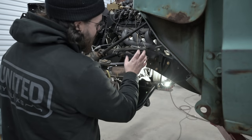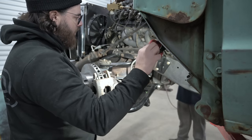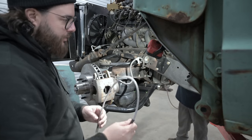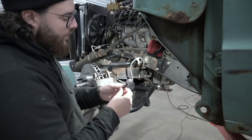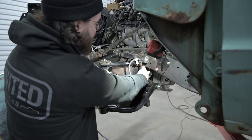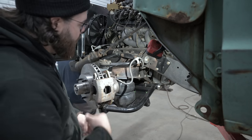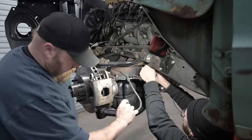Alright guys, so we're going to be working on the brake line here. These factory brake lines, especially with this little bend here, always cause me an issue here at the cross member. So we've got these Wilwood braided lines that we're going to use. I'll drop the part number down in the description, but this end should thread into this jankily run brake line under here. And then we've got the banjo 7/16-20 banjo fitting with the bolt to go on this end. So we're gonna pull off these old decrepit lines and upgrade with these braided lines.